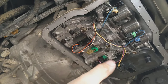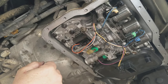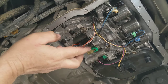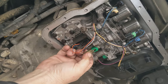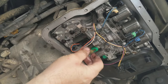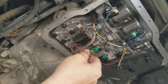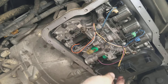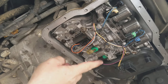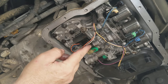We're going to put the gasket on the pan, put the pan back, and fill her up with transmission fluid. One more time: push this in, pull it out, snaps right back in, unscrew the bolt, wiggle and jiggle and it'll come out — same exact with this one over here. To get the filter off, take this off here — very simple, just pull it out, nothing to unscrew. Remember, I've seen videos where guys are trying to pull these out and they didn't pull the bolts out here that hold them in place.